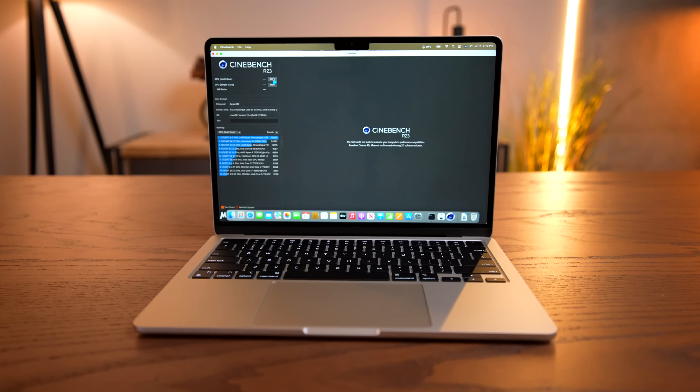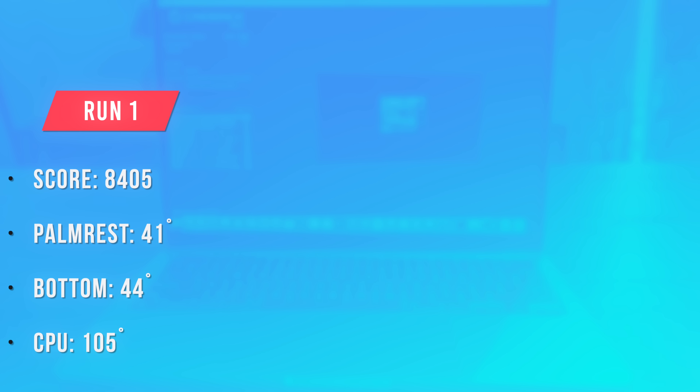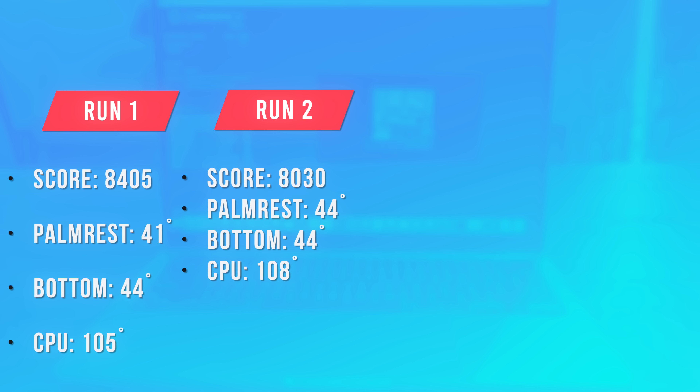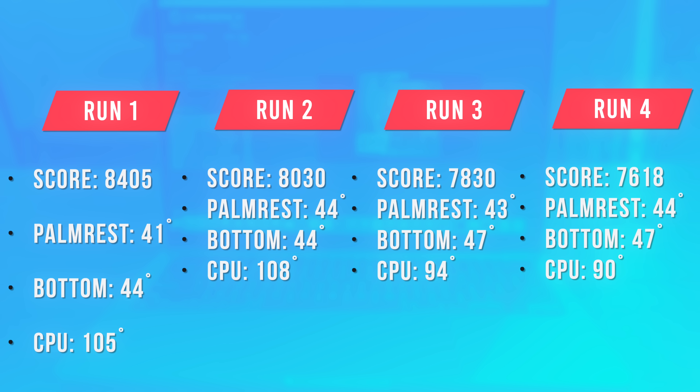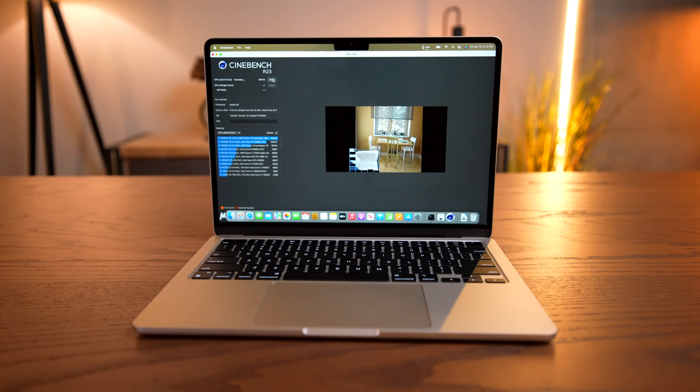A thing that really stood out to me in a previous video when we opened up the MacBook Air was just how big the heatsink is. So why not just cover all of that in thermal pads? The ones in blue are your standard cheap ones — around $7 for all four, with a thermal conductivity of 6 watts per meter Kelvin. When you're trying to dissipate heat, you want a higher thermal conductivity because that means it's able to transfer heat through the surface more effectively. The air gap that exists between the heatsink and the bottom of the case barely transfers any heat, so by using a thermal pad, we can transfer heat from the M2 chip to the heatsink through the bottom of the case and use that as a heatsink.